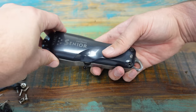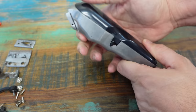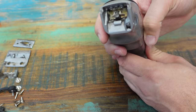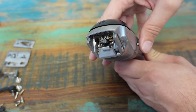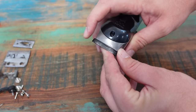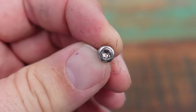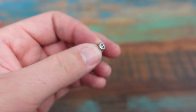I'll do the same with the lid — go around with the tool and scrape off anything on there, then brush off any gunk on the casing. Now I'm going to click the lid back on. It just clicks on, and it's quite firm, but you do need to put the screws back in as well. There you can see the little pin that turns the blade — it's slightly offset. This is what we couldn't see before; it was all surrounded by hair, no wonder it wasn't working smoothly. Now it's a lot cleaner and the blade's going to move nice and free.